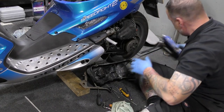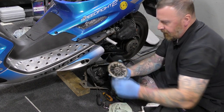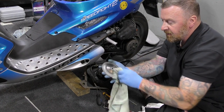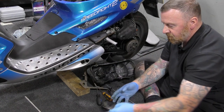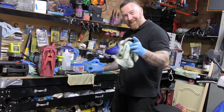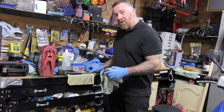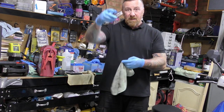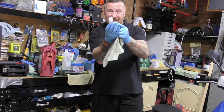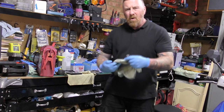Remember I said this time and time again — take this off, nice clean rag. You can see there's some dirt on here. Using my scales: eight grams. I say use six, and look — the middle bit is jammed. That's got to freely go through. So what I've found so far: it needs to be cleaned and freely move through.